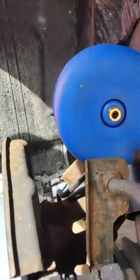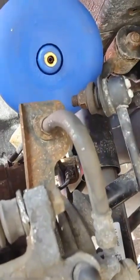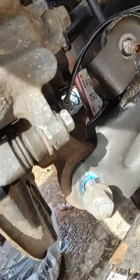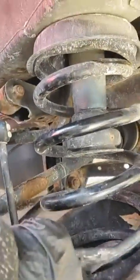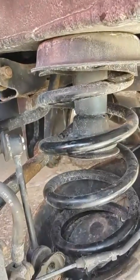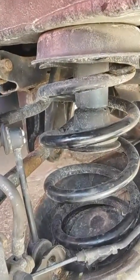It's pretty quick installation. You just take off your little stabilizer nut and take your control arm bolt out. There are just two 10mm bolts holding on this ABS line bracket so I can drop the control arm down and it won't stretch it out or anything like that.